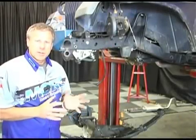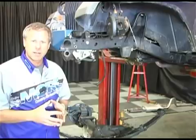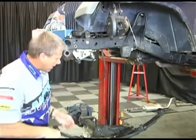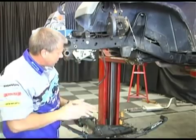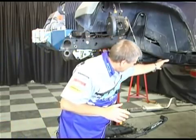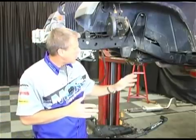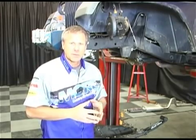In order to take down this application, everything's going to have to be unbolted. Now you're ready to start the assembly of the next part of this bracket. You've got a stock hanger right here — go ahead and cut and grind that off and clean it up real nice. Because if you do the bolt-on application, you need to slide that over close to that area. Or if you do the through-the-frame weld-in bushing, you're going to be right in that area as well. So make sure that's cleaned up and ready to go.